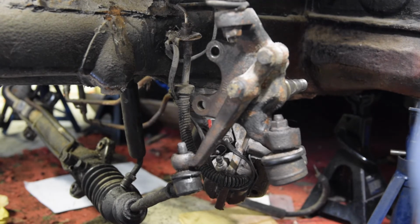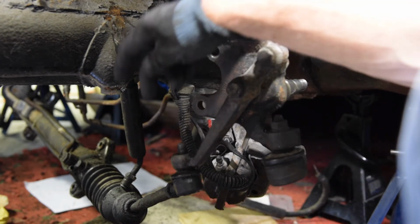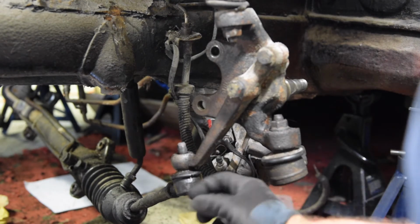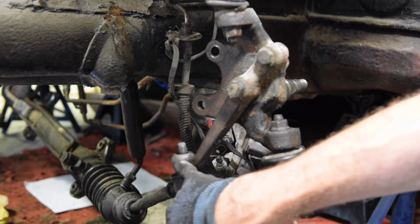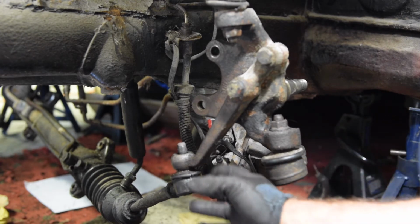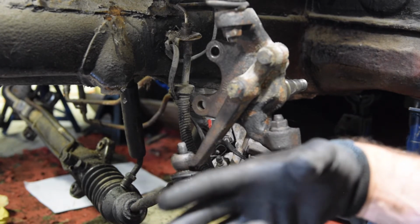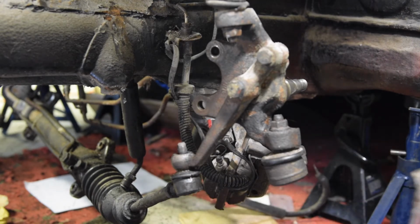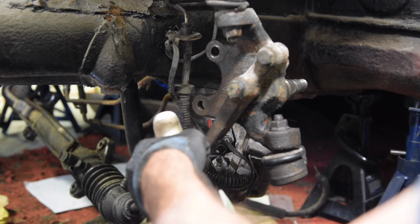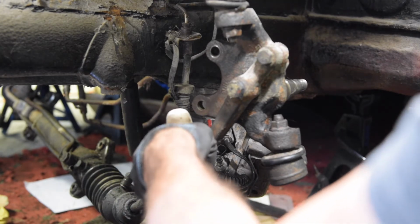I am purposely warming the stud. I know that that'll make that bigger and a tighter fit, but as soon as I apply any heat to the fitting, it's melting the rubber. So I figure if I just heat the stud up, it'll expand. Then when it contracts again, hopefully it'll have freed itself a bit, especially if I put a bit of my penetrating oil in there.